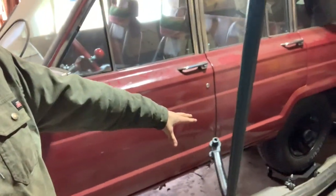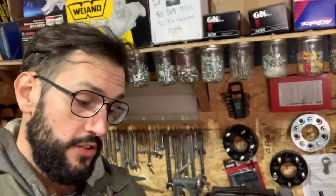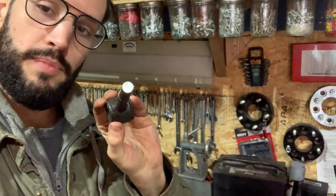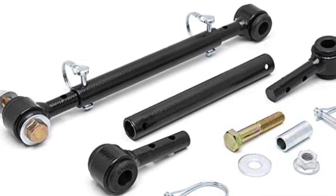I know what you're thinking — this frame is really awful, every six inches there's a giant hole in it. That is true, but after this hole there's a good part of the frame that goes probably all the way back to about this part, and on this side it actually goes all the way to there. Once all that is done and the frame is in good shape again — because the new suspension I'm putting on is a four-inch lift — that means my sway bar linkage is going to be too short. So I'm cutting them, sleeving them with a metal tube, and making sway bar disconnects, hopefully not too expensive. I'm basically refabricating the entire sway bar system, trying to keep as much of the old stuff as I can but making sure it is strong enough.